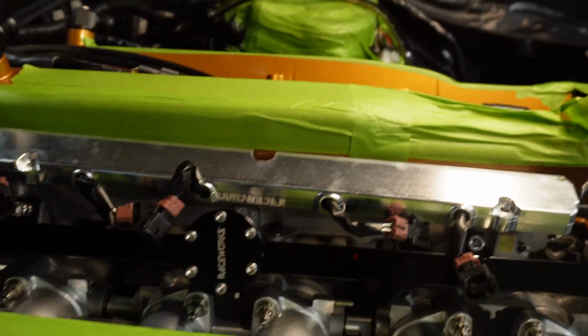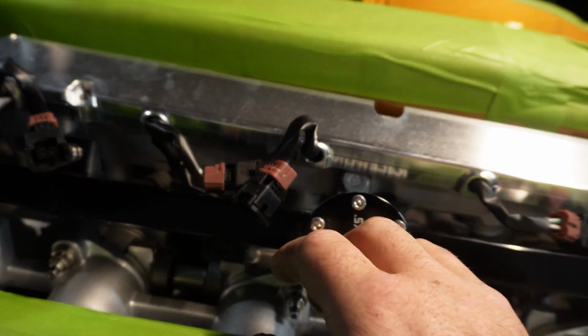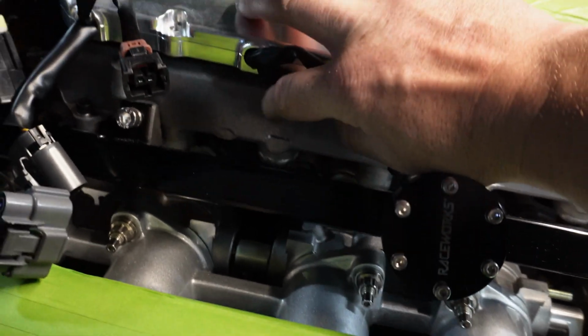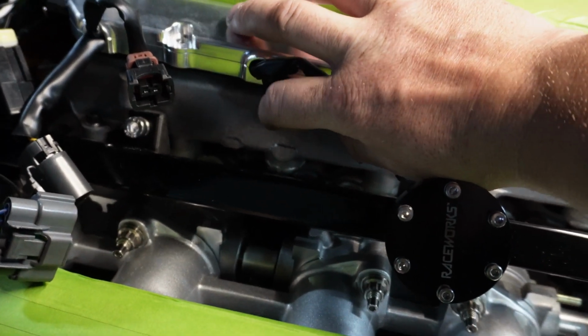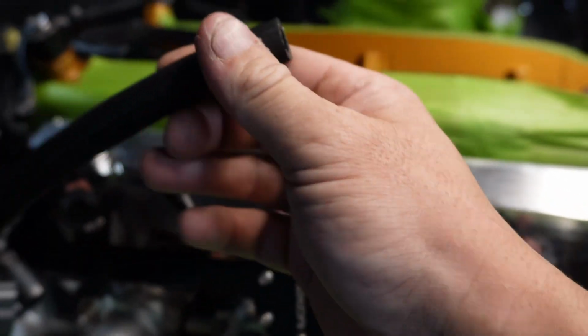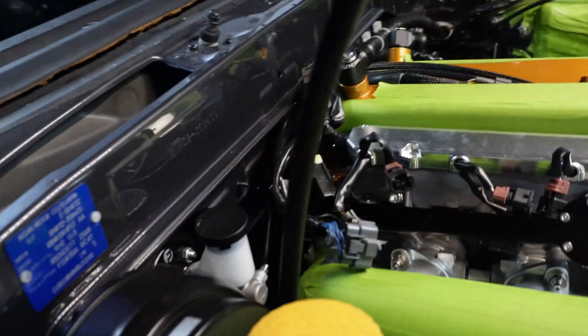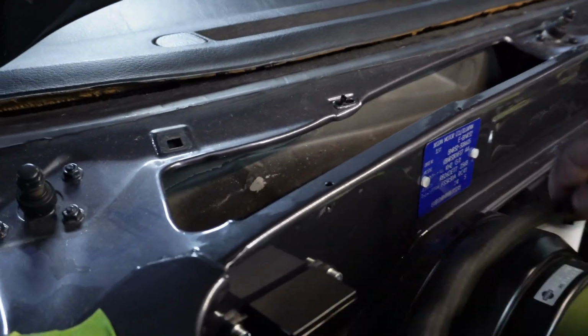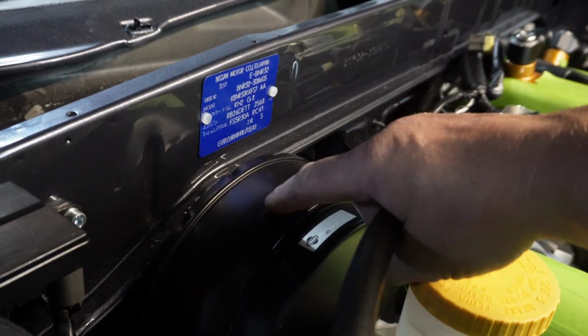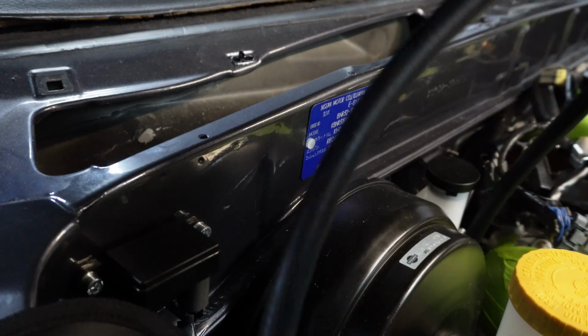New year, new me. When you get the Haltech drive-by-wire kit, it comes with the fittings which we had welded on, which we showed in an episode. We weld onto the vacuum rail, which gives us good manifold pressure and vacuum pressure, and I changed that over to this nice Raceworks E85 hose, so that's already there to go. Instead of going to both the clutch master cylinder and the brake booster, it just goes to the brake booster. So we'll tidy that hose up shortly.